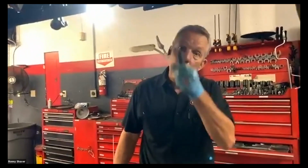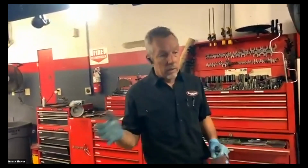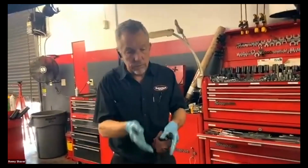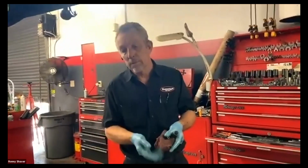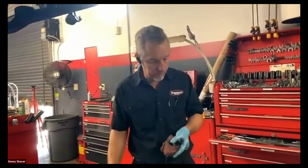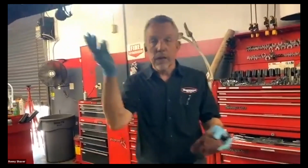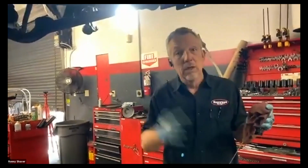The key to making sure you don't get leaks in that is to service your cooling system regularly. I say every 2 years. You should flush it and put new coolant and distilled water mixture in there. And that's just to keep the contaminants out. What happens is the cooling system is like a battery. A battery has two dissimilar metals and some sort of compound. Now it's a gel, but they used to use water with acid in it, and it creates voltage. And when you create voltage, you're going to get corrosion, and metals will sacrifice. That's all chemistry, and it's way over my pay grade.